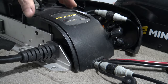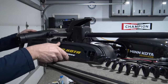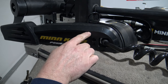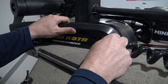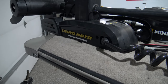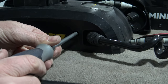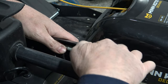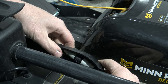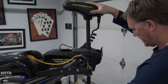Now go ahead and push your center housing back in place. You're going to want to stow the motor, then reattach the left side — the left side is the one with the cable going through it. Reinstall the two screws. The trickiest part is tucking this wire inside this housing, putting it back on so that no wires are pinched, and reinstalling the two screws. With the right side cover on, go ahead and deploy your motor. Make sure that your prop is out of the way of your trailer tongue.